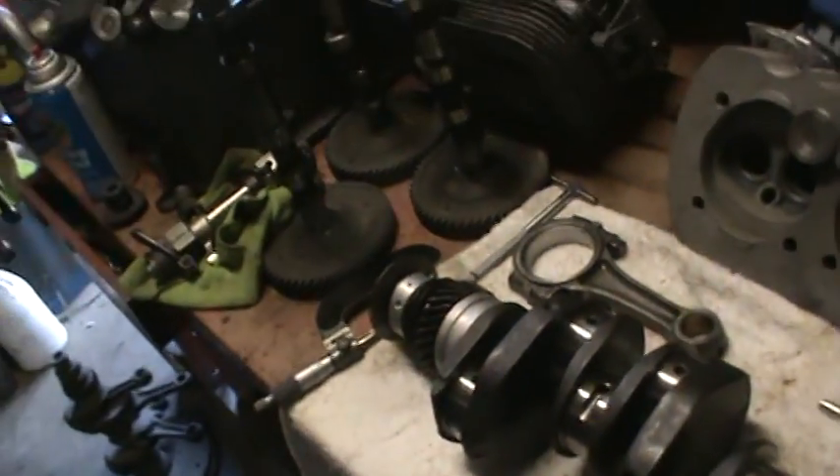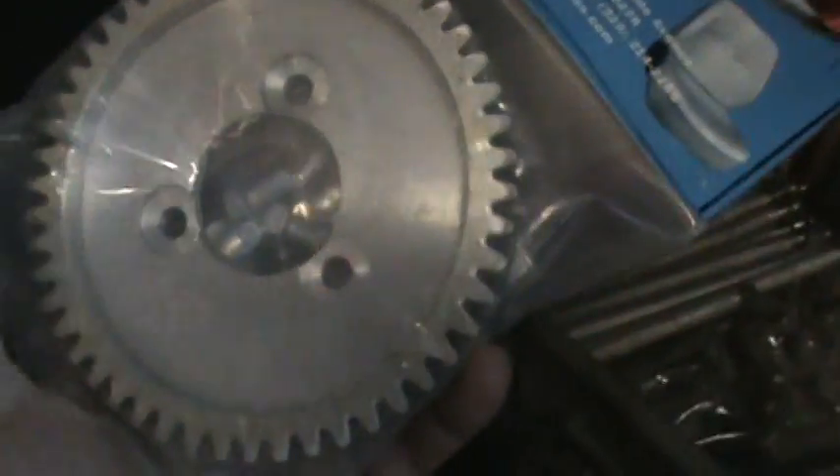For the super 1600, I usually go with the C35 Scat cam. That requires a couple things — if you're building that kind of motor, you have to buy the camshaft, you have to buy an aftermarket bolt-on gear, straight gear, conventional helix, depending on what noise you want in the motor. There's our Scat cam back there, a C35.